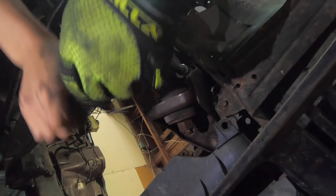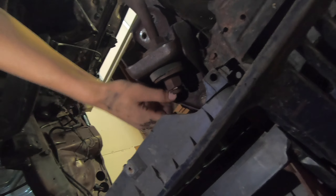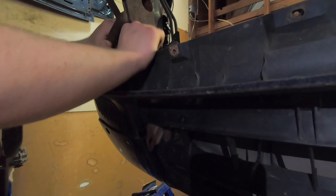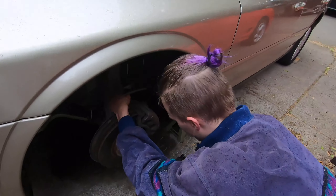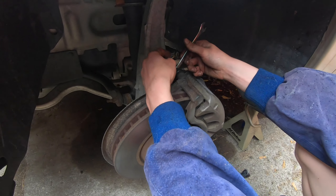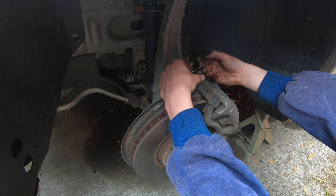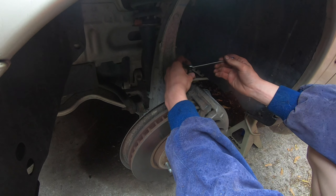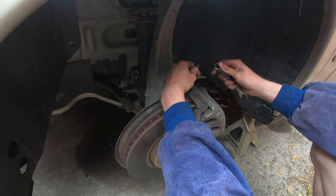I want to focus on getting the suspension on this car more dialed than worrying about how much power I'm going to make under the hood. With body weight, horsepower shouldn't matter too much — I should be able to be quick enough without a million horsepower. I got my box end around it and held it flush, then used a hammer to give it little taps to kind of work as an impact to break it loose. That seemed to get it off a little easier.